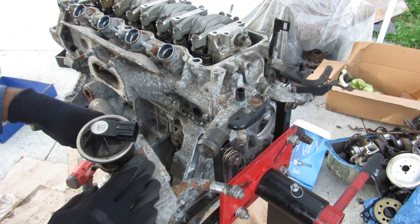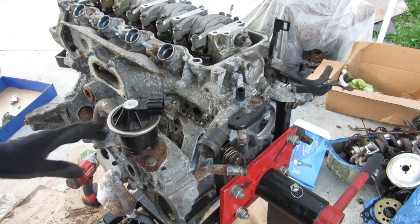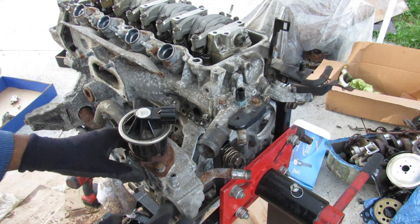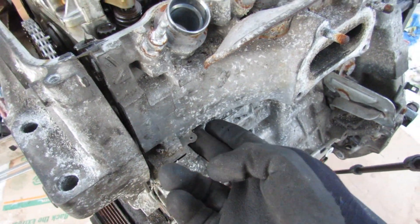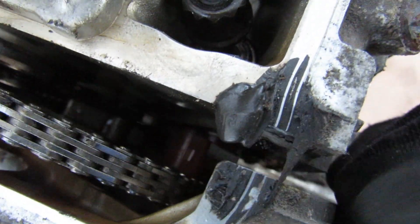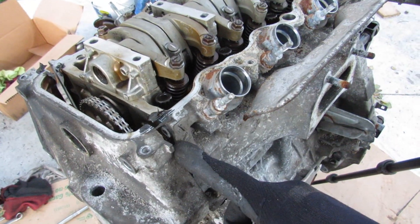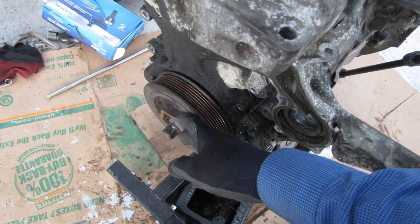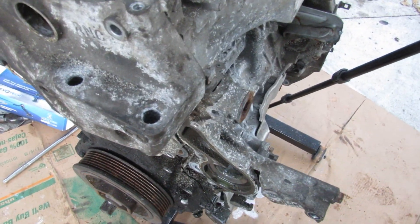You can see that this unit functions both as the EGR, where exhaust gases come out from this manifold, as well as the coolant passage where your thermostat connects. The coolant actually passes through the exhaust gas area and cools it down as it goes by. I thought I could lift up this head here — it is loose all the way around — but the only problem is there is a timing chain tensioner inside which is bolted to the head itself. So I can't lift the head out because the chain tensioner has to come with it. So overall I do have to remove this timing cover, which means I have to remove the crank bolt, and in order to do that I have to hold the crankshaft. We are going to spin this engine over and start working on the bottom.